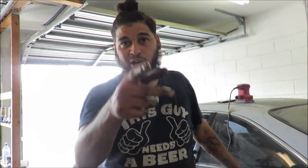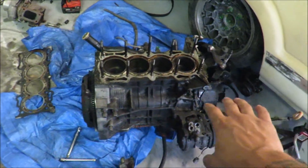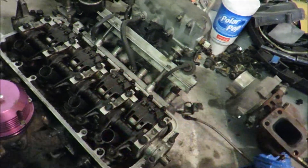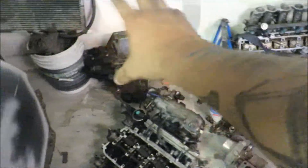I'm going to clean up, go get some food - it's Florida so it's hot - grab a Powerade, and then get back to it. I'm going to go ahead and pull the AC compressor off and pull the clutch and everything off so we can get to the rear main seal, because we're going to replace that. Everything else in here looks good. Later I'll get an engine stand so we can pull the pan and replace all the bearings. For the head, since this head isn't going to be used, I'm just going to pull the turbo manifold and intake manifold off and use all those accessories on the new head - and we're going to port the intake manifold as well.